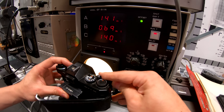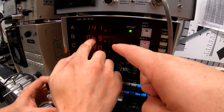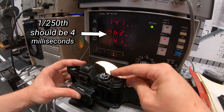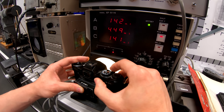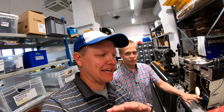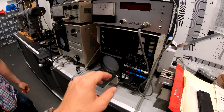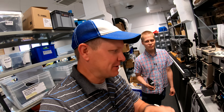Let's verify on the electronic machine. At 1/1000 speed - that should be one millisecond - but it's measuring 0.6 milliseconds. The 1/500 is kind of okay, and 1/250 is a little slow but still acceptable. So we took a completely analog, gut-feel method and we were able to get a discrete, accurate reading confirming the camera is firing faster than one thousandth of a second. We measured below a millisecond in technology dating from 1920-1930.